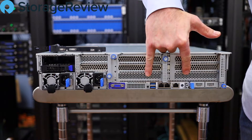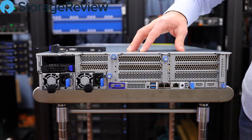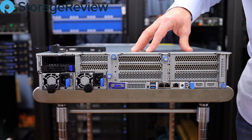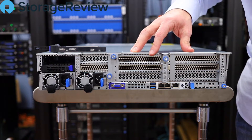We do, however, have two PCIe Gen 4 x8 bays available, and we'll have some opportunity there. We're going to need both of those most likely for connectivity to make sure we've got good I/O to and from the box. Because this system will be able to generate so much computational power and storage I/O, having those two available for networking is going to be critical.